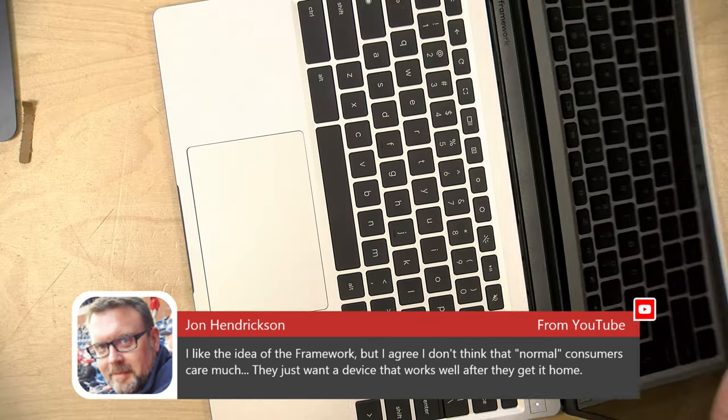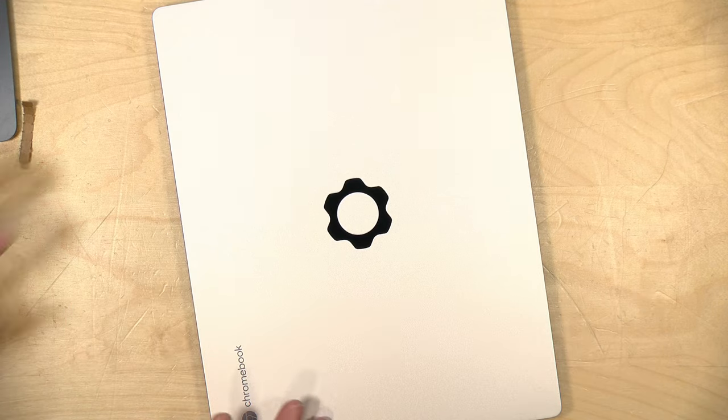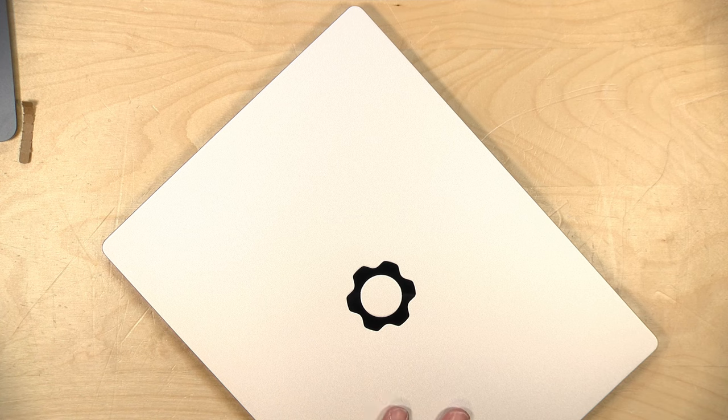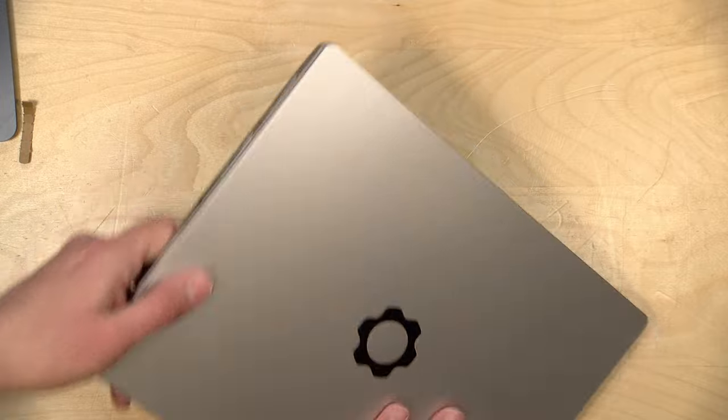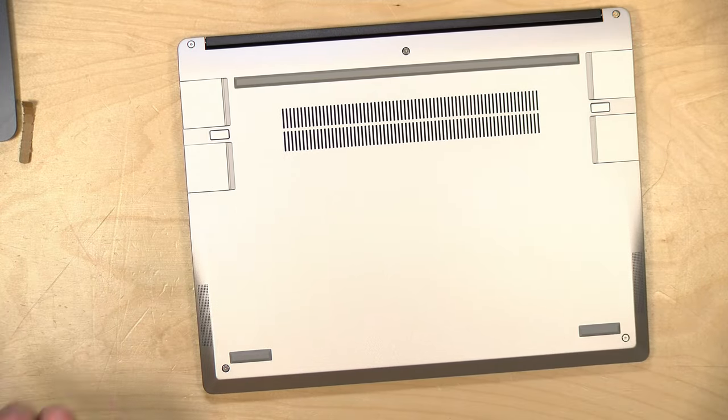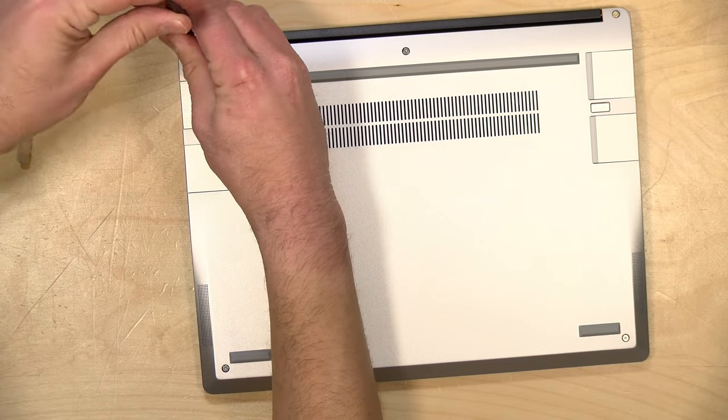All right, so what we're going to do now is we are going to upgrade the RAM on this. And there's a guide to doing so. So what we have to do is pull the power off and shut it down, which we did. And we need to unscrew the 5 fasteners on the back cover and then lift up the input cover, and then we can get at the memory. So that's it. It's pretty basic. And we're going to use the included screwdriver here to do that.